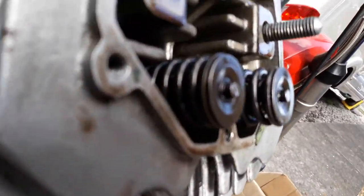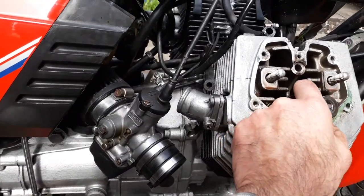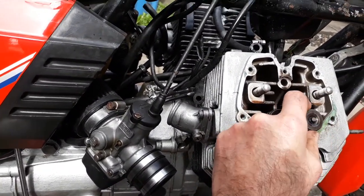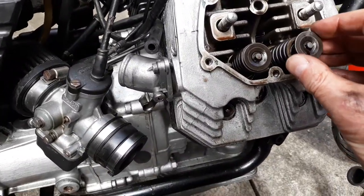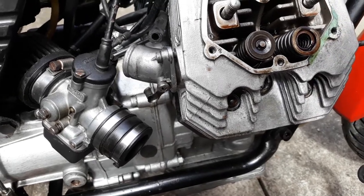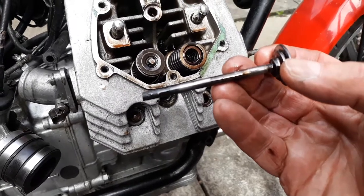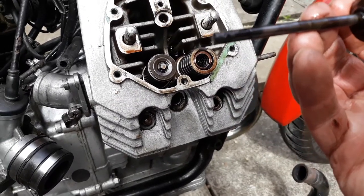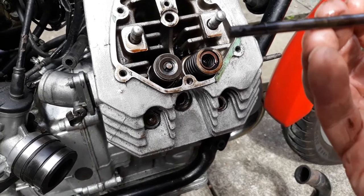You can see that they're not. The spring on the exhaust valve has no tension — in fact I can lift the exhaust valve out completely, which suggests the exhaust valve is actually broken. And there you are, you can see live on screen that the head has completely snapped off the exhaust valve.